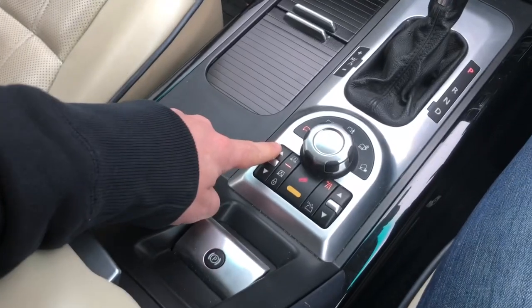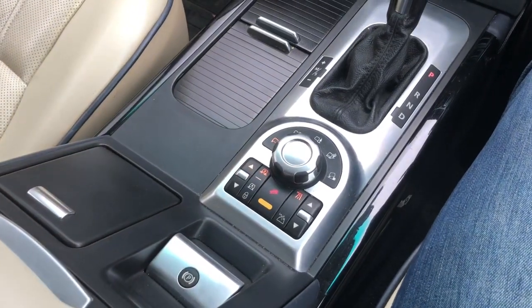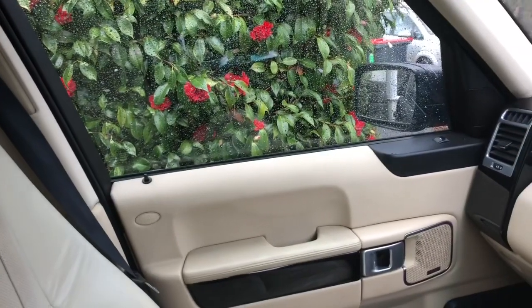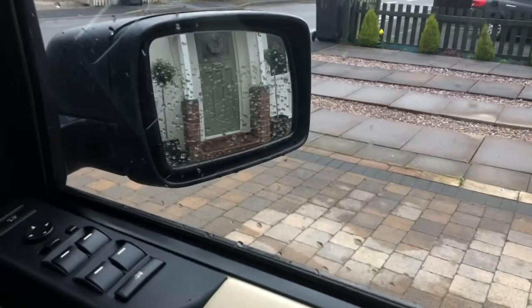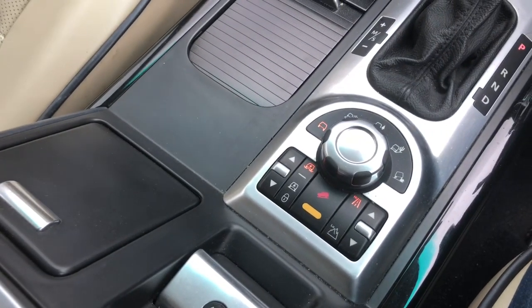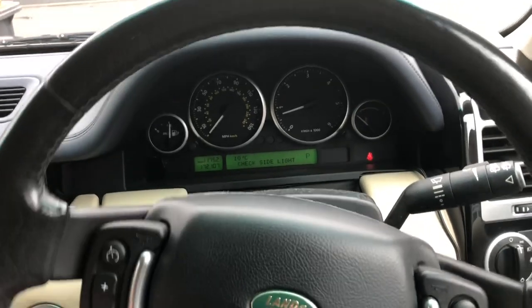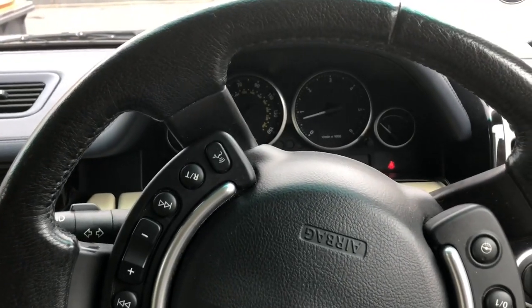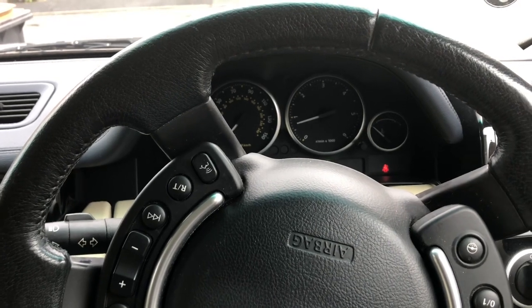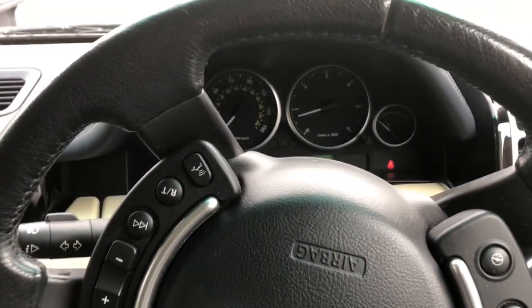Then the last thing I would do is mess about with the air suspension. Don't mess with it necessarily, but put it on — we're going to raise the suspension up a little bit. Check that you're actually raising. I can feel the vehicle going up right now. Does it raise properly? Feels like it's pretty much got there. And while you're in here, before you turn the engine off, put the vehicle on full lock one way or the other. So you're on high suspension with the vehicle on lock and you can go and have a look at some of the stuff that's difficult to see on the outside — in the front wheel well. Let's go and have a look.